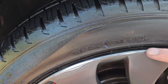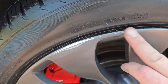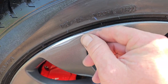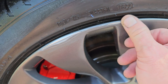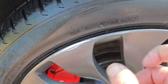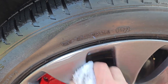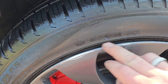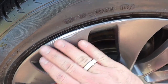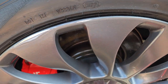I've worked my way up to the 2,000 grit and it's perfectly smooth - I can't feel any little nicks or get a fingernail caught on it at all. I did a little bit further down too just for blending, and gave it a slight scuff so the paint has something to bite into. Next I'm gonna spray it with alcohol, wipe it one final time, and then start masking things up.